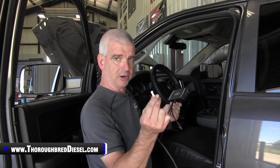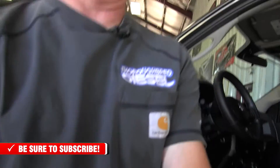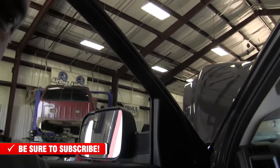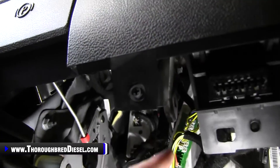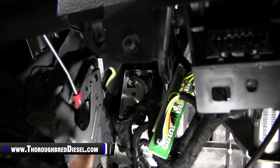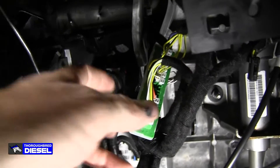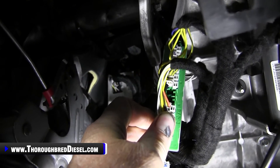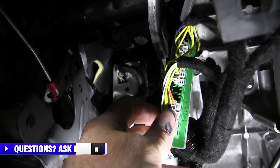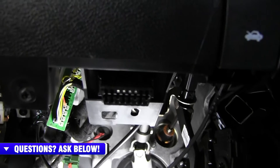This is your CAN-C star connector. The CAN-C star connector is underneath the dash, close up, almost directly in the middle towards the driver's side. It's a long green connector set. Here is your OBD2, and here is the CAN-C connector — you can see some open orifices, and the connector can go into any of those for your EZ-Link. So we're going to connect that up, then hook up to the OBD2 port, turn the key on, and have power to our EZ-Link.